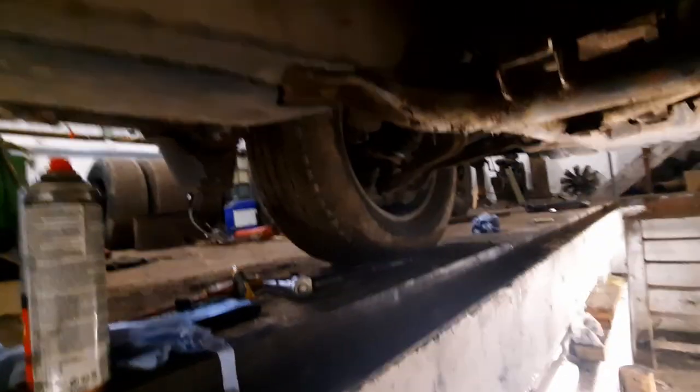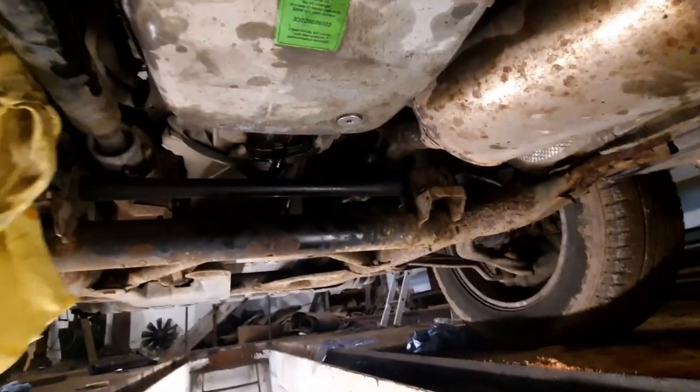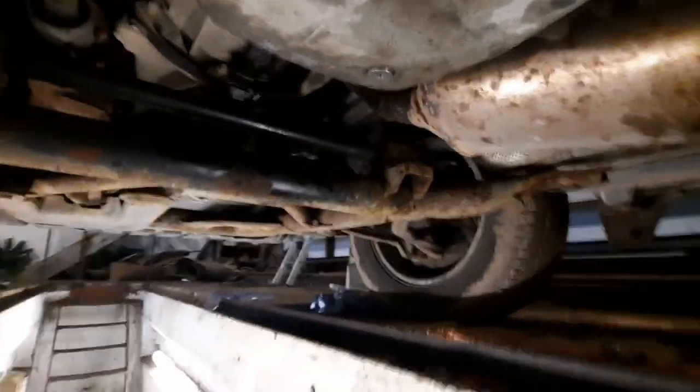So, we've got approximately 5.2 litres into it, and it's just started to leak out. So, let's snip this and pull the hose out. I'm just going to sit it there because we're going to have to refill it again soon. I need to find the drain plug, which is here, and close it up.